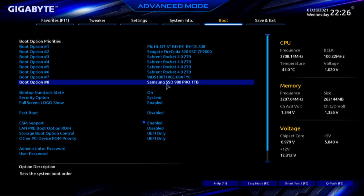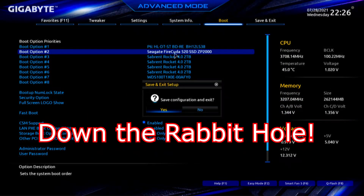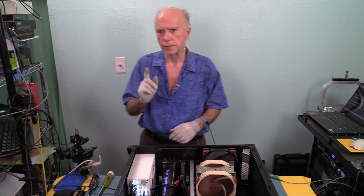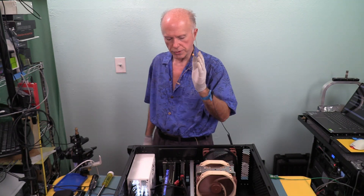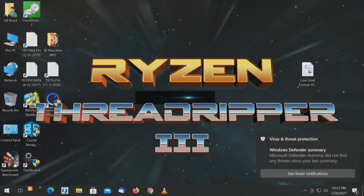What a dog and pony show. When we reboot, because we are not in RAID, we should boot to that drive. F10, save. We are now at a little over two hours doing this. Save configuration — let's see if we boot to that drive on the motherboard. First it'll look at the Blu-ray drive, then it'll come down the tree to the Seagate FireCuda. We hear a post. We picked up the drive, it's got Windows, we saw the loading screen, we're into Windows and booting off that drive.